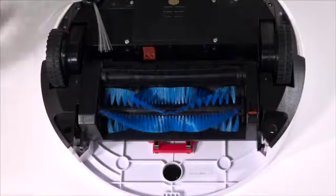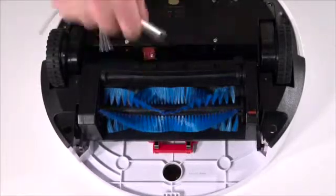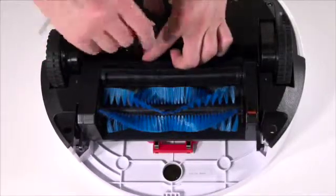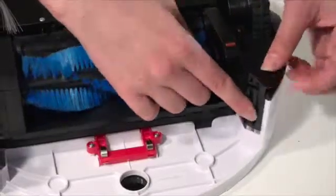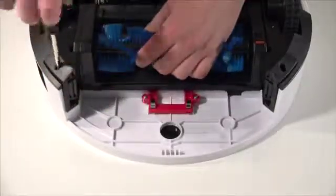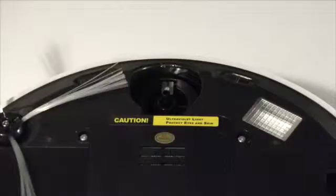Line up the red brush fastener on bObi and replace its 2 smaller screws. Place the main brushes back before you install the 2 screws close to her dustbin. They secure the main brush on bObi. Replace the front wheel, and your repair is complete.